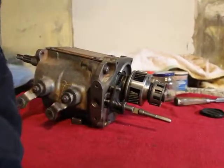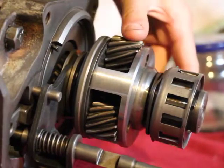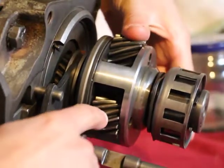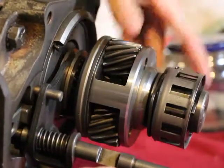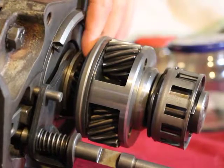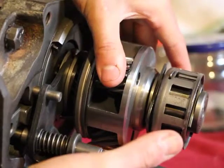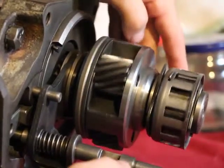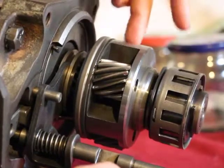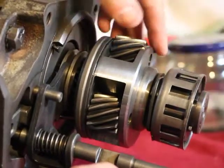Sorry for another little video, but when the ring gear, which is the output shaft, is around these gears here and the sun gear inside there is locked, that outer gear doesn't lock these three planet gears. It just forces them to keep turning — they turn around the sun gear, which forces the main shaft to turn.